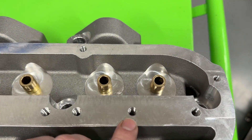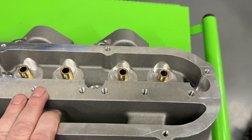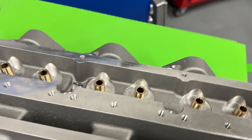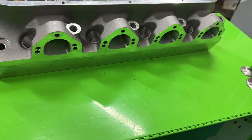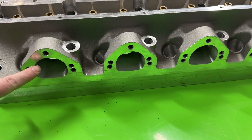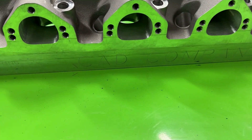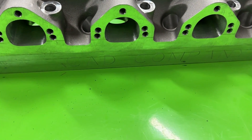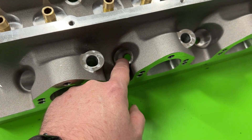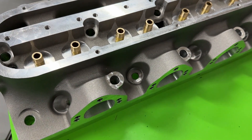The only thing I'm not a fan of is these fasteners are really small that hold down your rocker stuff. I don't know how well that works, but I don't think these turn a humongous amount of RPMs — not 8,500 or anything. Here's the exhaust view. They're D-ports, which is fantastic as well. It has multiple patterns for different headers from Cadillacs — I'm not as familiar. And it's nice — super nice stuff. Here's what I was talking about with the spark plug: instead of having it machined as deep, he just had it machined not as deep, so the spark plug engagement's at the right point.